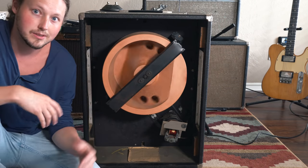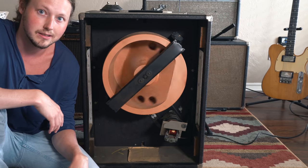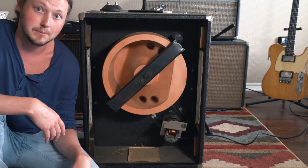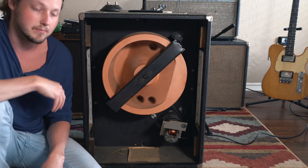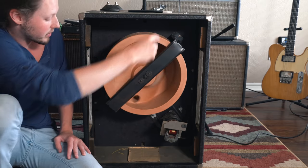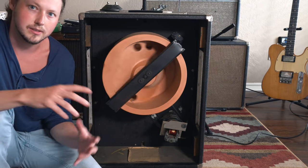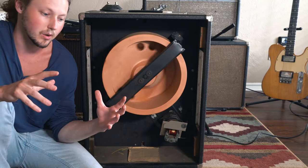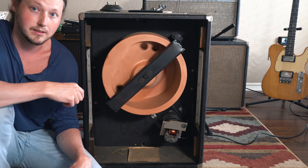So I was hoping there was something obvious inside here that I could fix and maybe tighten up to get this thing to work a little quieter, but nothing seemed to help. So I ended up pulling off this styrofoam mechanism. There's a couple screws, one up here, one here. I pulled this whole assembly out, and then I could notice that the styrofoam cone was kind of loose, and so I was able to tighten it up a little and greased everything, put it back together.